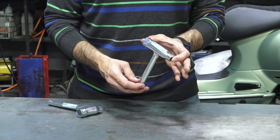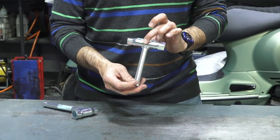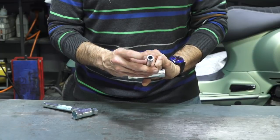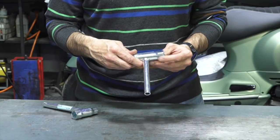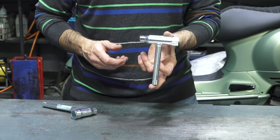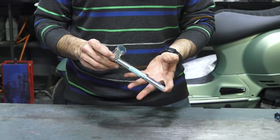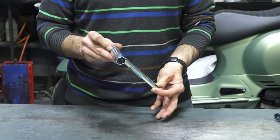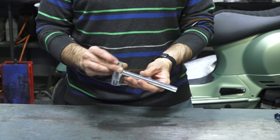Another important tool to carry with your vintage Vespa is the T-handle tool that's specific for a large frame Vespa. It's got a 13 millimeter socket, a 13/16 spark plug socket, and on this end, 11 millimeter. A lot of the fasteners on Vespas have 11 millimeter heads, so this works out quite well for basic repairs such as changing the spark plug or swapping out a spare tire. There's also a small frame version — the same T-handle tool but modified for the small frame, which has limited access for removing the spark plug.